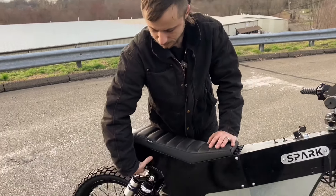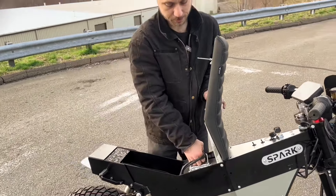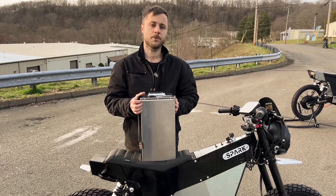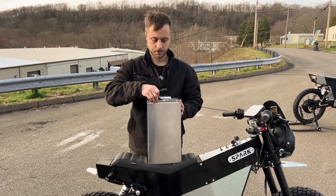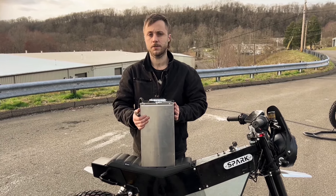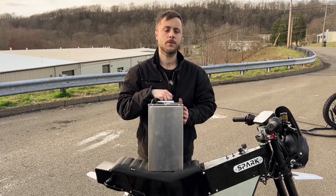While we're on this side of the bike, the seat actually folds forward by hitting a button located underneath. I can hit that and it pops forward, giving me access to the inside. I can disconnect my battery, pull it out, and put it on the ground. There's also a massive cavity in the back — big enough to hold your charger or any other gear you want to carry with you. This is the battery: a massive 40 amp hour, 72 volt battery with a 100 amp BMS, using a QS8 connector, and a standard charging port located above. There's a little screen on top that shows you how much power there is, and a simple power switch to turn it off. It's made using a stainless steel enclosure and is very scratch resistant. It can achieve a little over 100 miles in low power mode, or more like 40 to 50 miles in the higher speed modes.